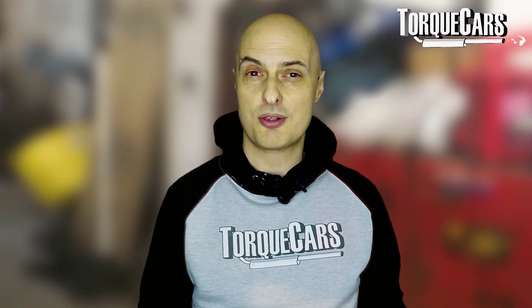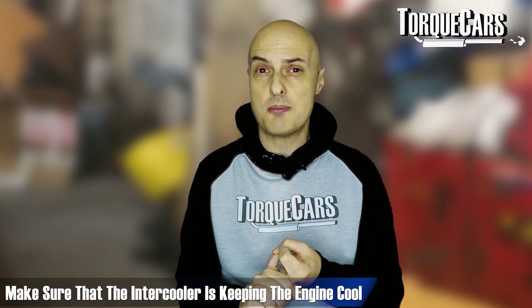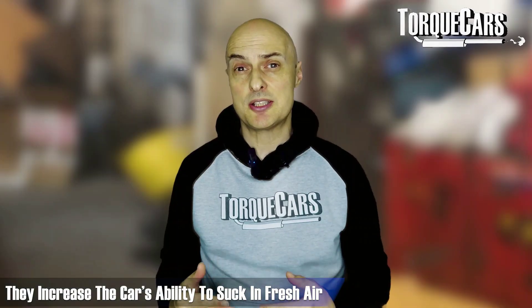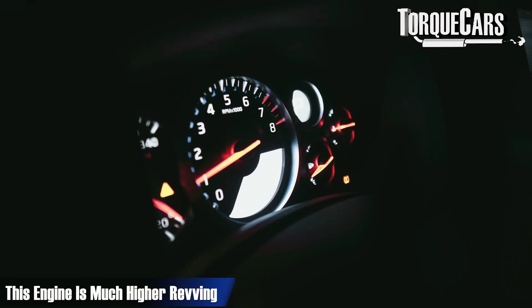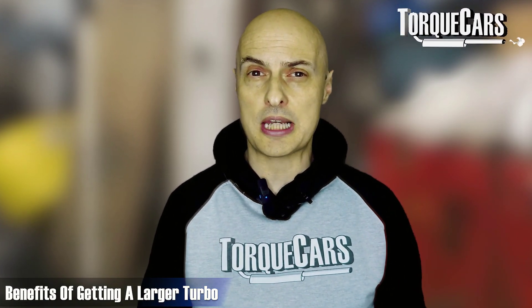Turbocharged rotary engines are certainly very interesting to tune. The basic principle is getting more air into the engine to burn more fuel, and with a rotary engine you seem to get a lot more out when you start adding tuning mods. Uprating the turbo is a significant modification — larger turbos dramatically increase the car's ability to suck in fresh air. Bear in mind this engine is much higher revving with much greater airflow velocity, so you need to choose a turbo profile suited to that setup. You will still experience some lag at the bottom end, but getting a bigger turbo will make a significant difference to overall power.